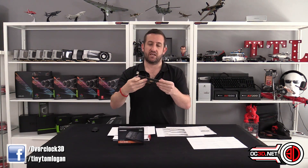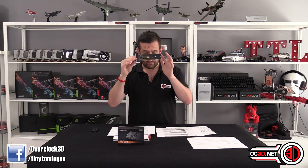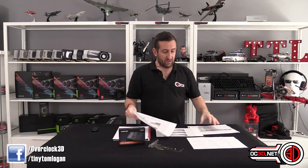We tested the hot and cold results in a normal board as it would normally be screwed in, on the Maximus 8 Formula which has a big cover on it, and also with add-in cards — and they're all the same. The heat and performance difference is consistent regardless of where you put it. Also, the X99 results were marginally behind the Z170 results — possibly because with Z170 the driver uses PCIe lanes from the chipset rather than the CPU. It could just be drivers, and I'd expect X99 to catch up.